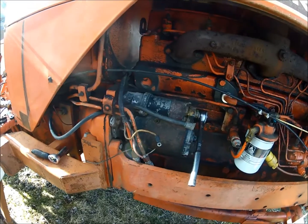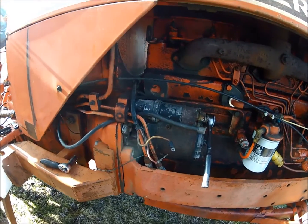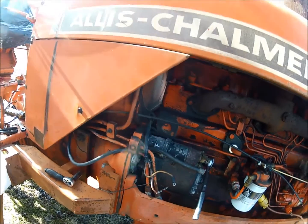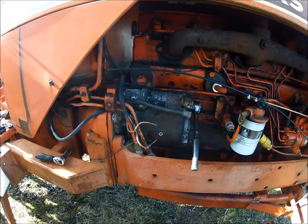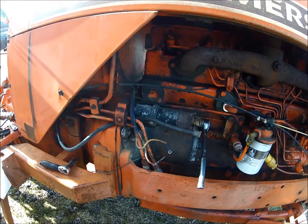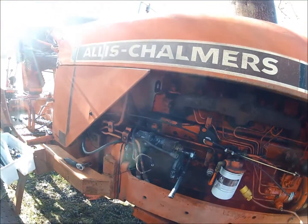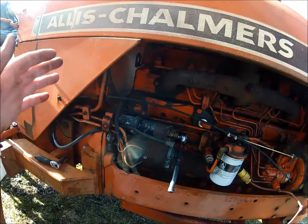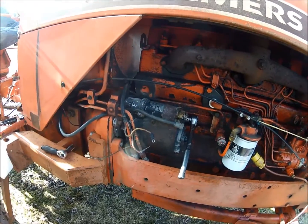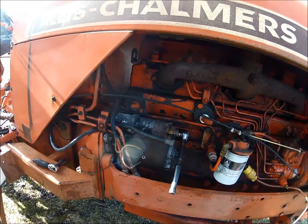I'm also going to look in there and see what's going on with the flywheel. I'm almost guaranteed that they're rounded over some. And if I can get in there and dress them up somehow, I'll try. I don't know how I could do it. A file is the only thing I would have that maybe will get back in there and dress some of them teeth up. Like I say, it always stops on that one particular point. Once you get it past that point, then it'll engage and it'll start. So, I'm hoping it's sitting at that point right now.